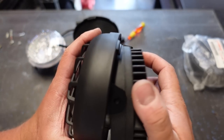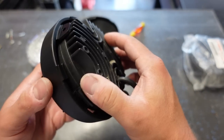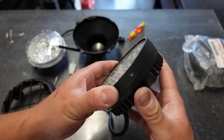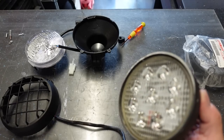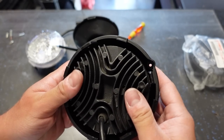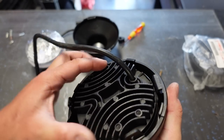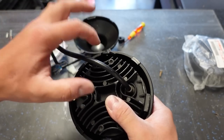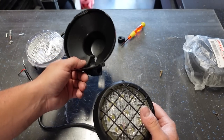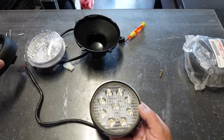I was measuring and check this out — these lights damn near fit inside the OEM housing. I chopped off the bottom piece, rounded it out, cut the little hood on top, and made it so it could fit in the housing. It literally fits perfect. All I've got to do is utilize these two holes and put a brace across the back with a screw, then maybe put silicone in four spots to cushion it from moving. And boom — we've got the power of these headlights with the look of OEM. I was going to get ones with halos like I have on the Voodoo Banshee, so I went to look online. At the top I'll show you what I ended up ordering.